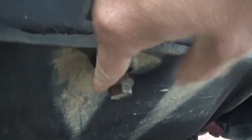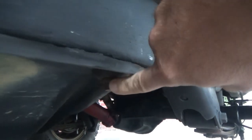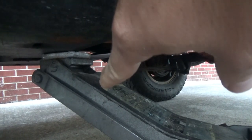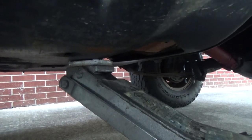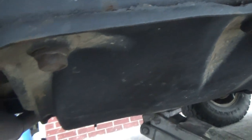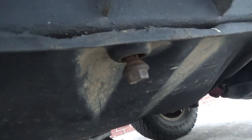I've already got this started and loosened up a little bit. We've got bolts here and here — six total, three on each side. I need to loosen those up. I've got a jack to support it, so I'll drop the skid plate and transfer case down enough to create a gap where I can slide my washers in between, then put the new bolts in. I'm going to go ahead and pull these bolts out while the jack is supporting it.